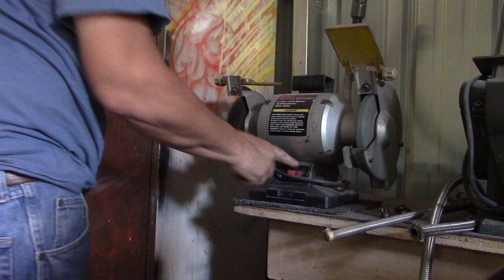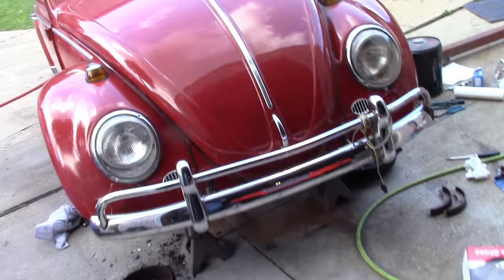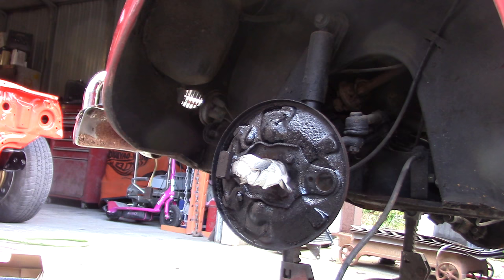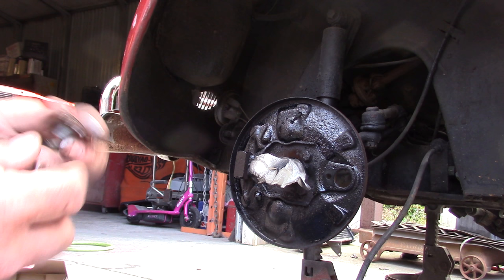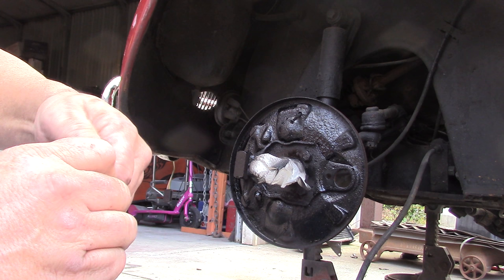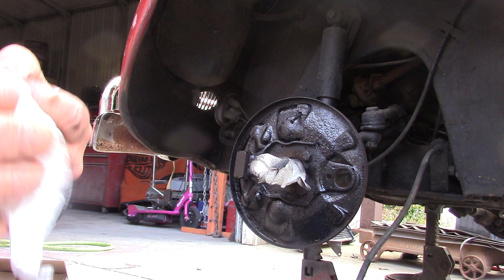On to the next part. My wife was trying to hijack my Gorilla Glue. Now we need — I like to use white lithium grease, you can use whatever you like, this seems to work good for this situation. Put a little on the adjuster, put some in the hole there. You want these to work freely all the way to the bottom. Wipe that excess off and put it on the barrel, then take the paper towel and just give it a wipe down so you don't have grease flying around in there.